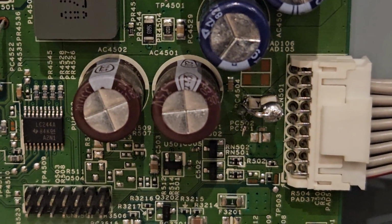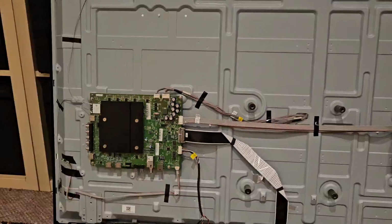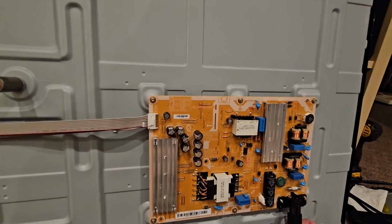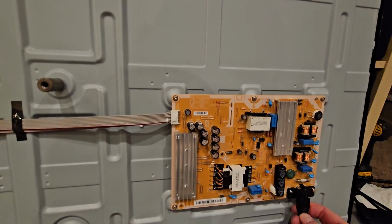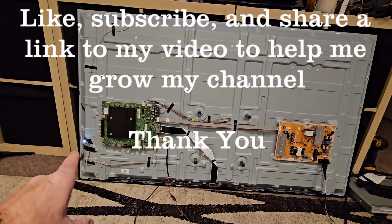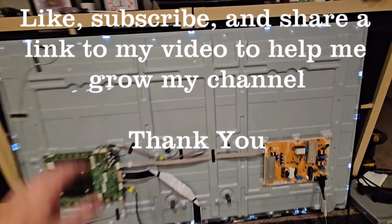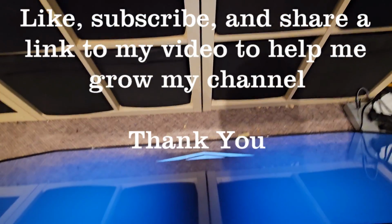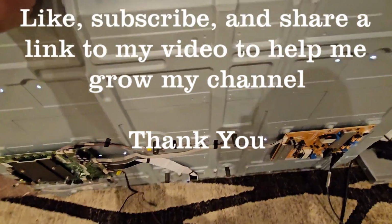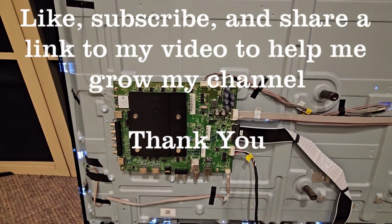Okay, we have the new fuse in and the board installed on the TV. We're going to hook up the power and see what happens. We got the power light coming on over there. And look at that, the backlight's on. TV's powered up. So to fix this TV is a 10-cent fuse.